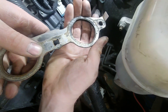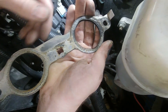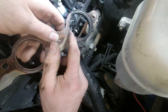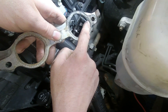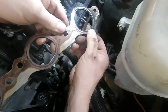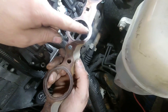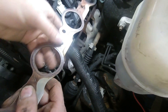This side has a smooth surface with blotchy contact spots. That's because this has a bigger flat area, whereas this has a ring going around it — the raised section contacts the manifold, and this contacts the head. They do seal up once it warms up and gets full contact, but until then it's vibrating. This other one shows nice smooth contact all the way around, shiny and much wider — that's because it's not leaking and making better contact.